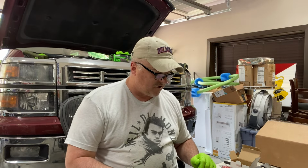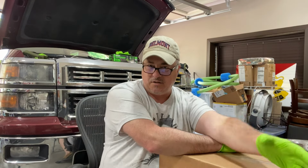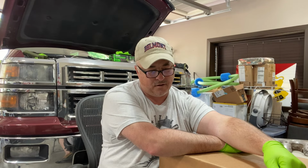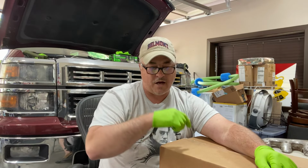But anyways, I want to talk about these exhaust manifolds and why I'm changing it. These stupid things are notorious for warping, okay, on this Silverado, and these 5.3 liters. And 5 years ago, I failed inspection on my truck because it was making a ticking noise. It sounds like lifters. And what happened is that the bolts on the exhaust manifold broke on the very back.